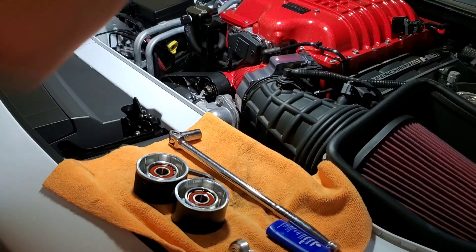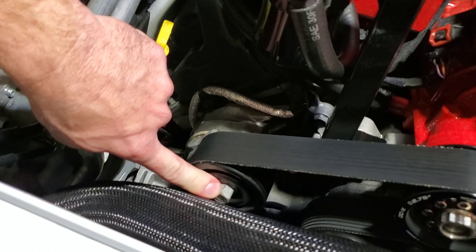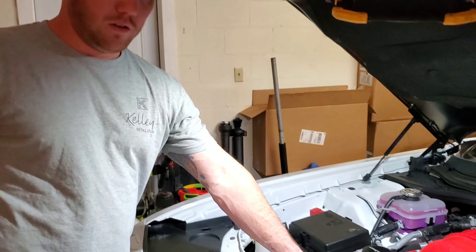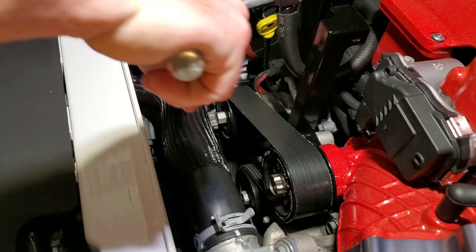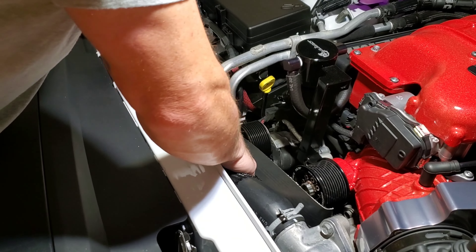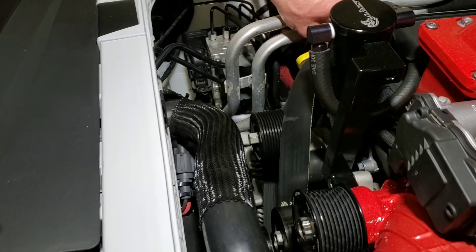I was right, it is a 15mm to get access to both of the factory bolts. You'll see this is the first pulley that has the ribs, and then the smooth pulley is right here. To get started, I'm going to go ahead and crack them loose with the belt still on. Once you get it loose, just crack it loose, because once you push the tensioner forward to relieve the belt, slide it forward, get it off the pulley, and slide it off.